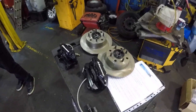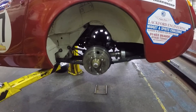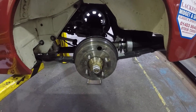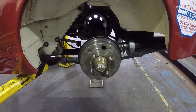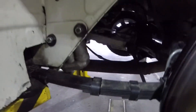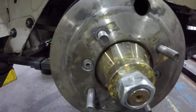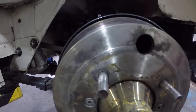New kit here — JLH Motorsport. Right, rear drums — we'll take these off. The only things different about this car are uprated springs, competition half shafts, different muffler, it's got a limited slip, and it's also got adjustable lever arms. We need to remove the allen head screws to get the drums off. We'd already taken the shoes off previously, but to move the car we had to put the drums back on.